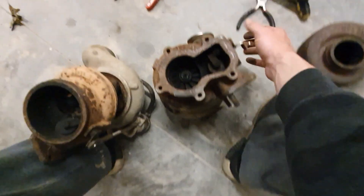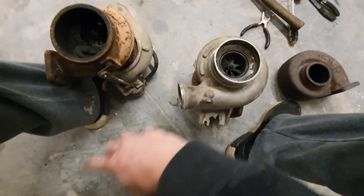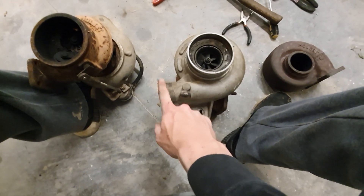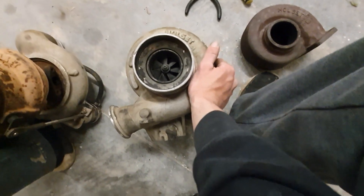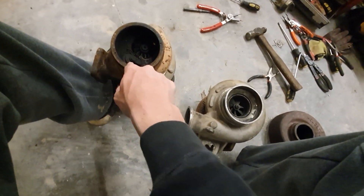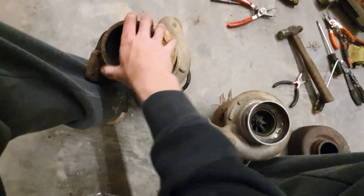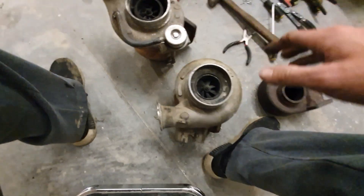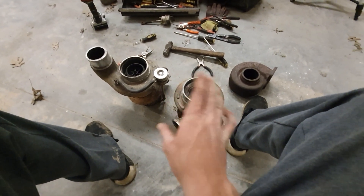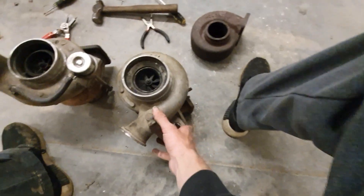You've got your HY35 intercooler connection — your elbow comes off just like normal and goes to your intercooler. If it's not intercooled, you'll need a crossover pipe that will accept this size because the factory one won't accept the same V-band connection. So we've discussed the hot side — this thing makes the power, it has crazy fast spool, this is what you need. I'd mill this to accept a 76-67 turbine wheel and plan on building one for turbo testing on the 89.